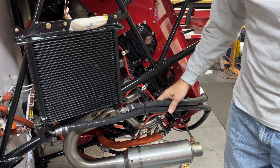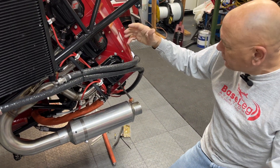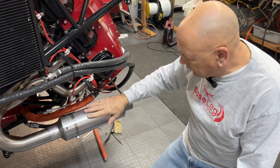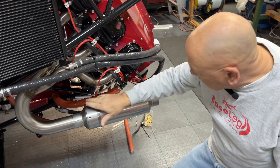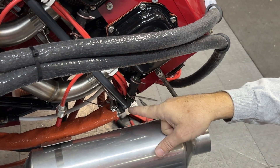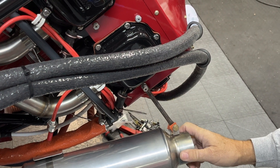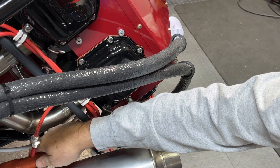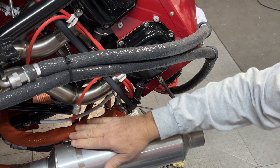I've got all the rubber hoses installed up to the oil cooler. I've fire-sleeved most everything after the firewall where it was practical. Normally I don't fire-sleeve oil cooler hoses, but I don't want to pick up any extra heat in this compartment, especially in a hover — perhaps radiating off the exhaust stacks. On the cylinder drain-back hoses, the cylinders are at an angle so we've got to collect oil through a rail tied into each cylinder and back to the oil tank. That runs close to the exhaust muffler, so I've fire-sleeved those hoses and used exhaust standoffs to get the hose away from the hot muffler.